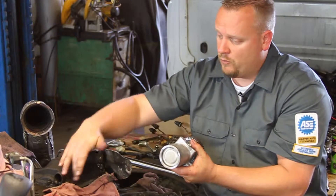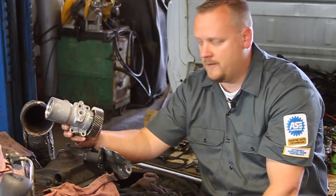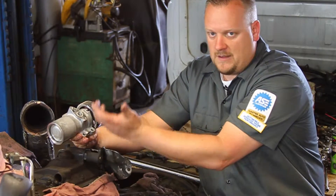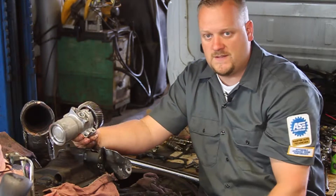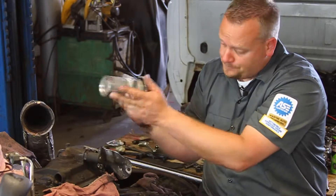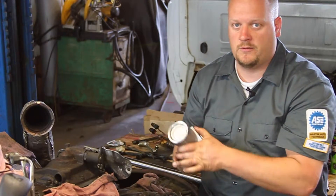Now that we're down to it, we're going to remove a couple bolts here, get this housing off, and we'll find the pump submerged in oil. It's gear-driven off the back of the engine, so we're going to go in there, suck the oil out, clean up surfaces, put some new O-rings in, and put this new pump in place. While we're in there, we're also going to replace the IPR and the ICP — it'd be a shame not to do those while we've got them out in the open here. We'll button up the job and resume what we were doing originally.